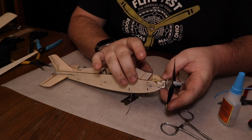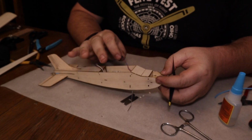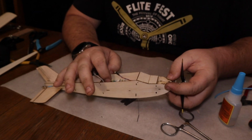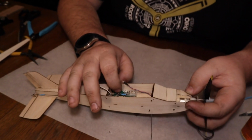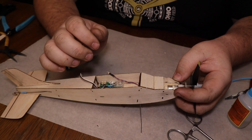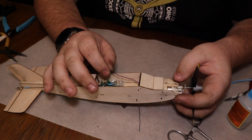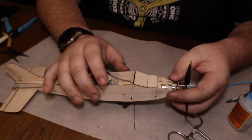One thing you will want to try to remember, I haven't gone over this yet, but when you unplug your motor, try to remember exactly which side it plugs into. One of the sides, it will work fantastically and actually plug in and have throttle function. The other way is just on throttle the whole way because you're connecting just the power and the ground, not a signal. Since this is a brushed motor, it only needs the signal and the power wire to work.